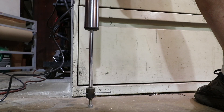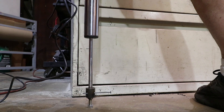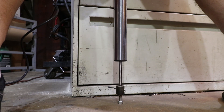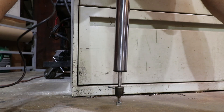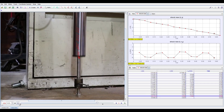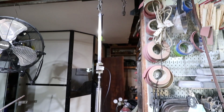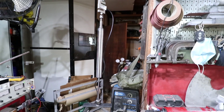Slow speed. Medium. This is the video tracker tool — you can see those red markers tracking each pixel as the shock travels down. It plots the position on the y-axis and the velocity here averages about seven. This graph shows the force from the load cell. At medium speed, it generated about 90 pounds initially, then tapered off to about 80 — I wasn't exactly even. And for the extension, here's the apparatus I tied to my ceiling to pull down.